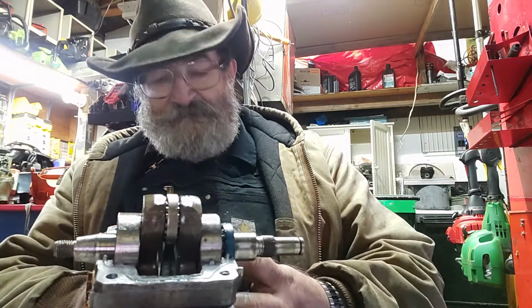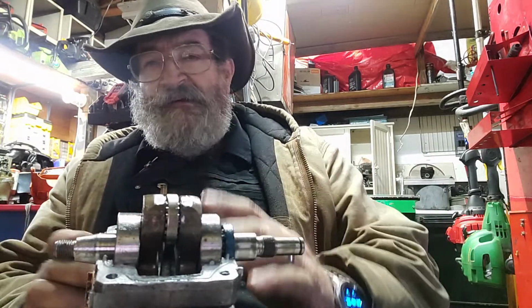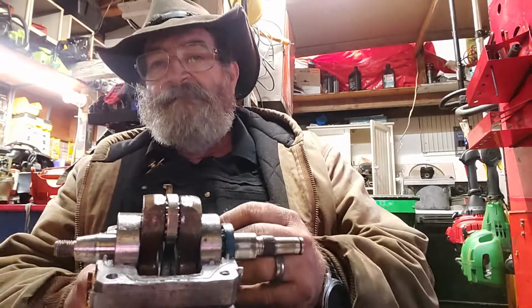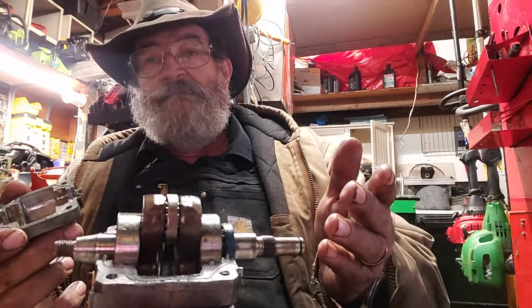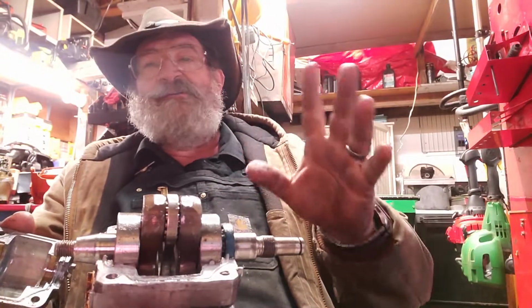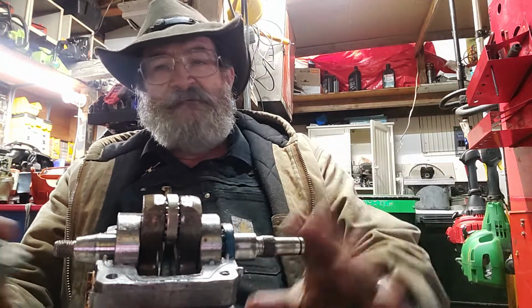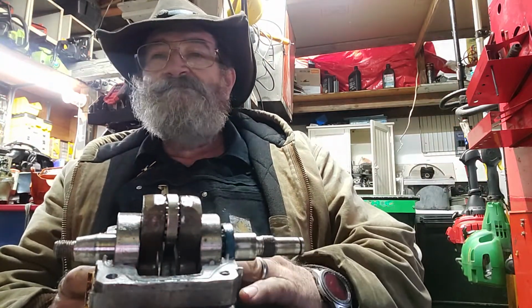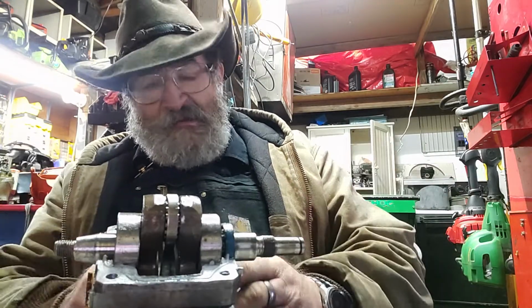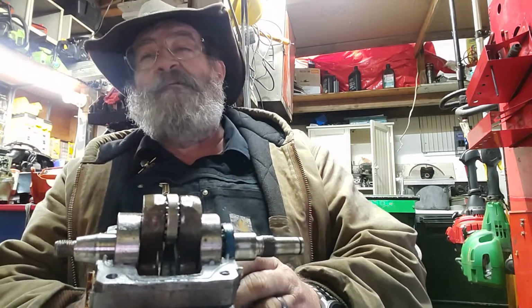I just don't. I'm paranoid about having anything on that belly pan or anything on that seal. The only thing you ought to have on there is metal, aluminum and sealant, and that's it. You shouldn't have the natural human oils on your skin. You shouldn't have gas. You shouldn't have nothing else. Just the aluminum and the sealer. And if you got to wear rubber gloves to accomplish that, do that. I got a banged up finger that doesn't turn, so I have a hard time wearing rubber gloves.